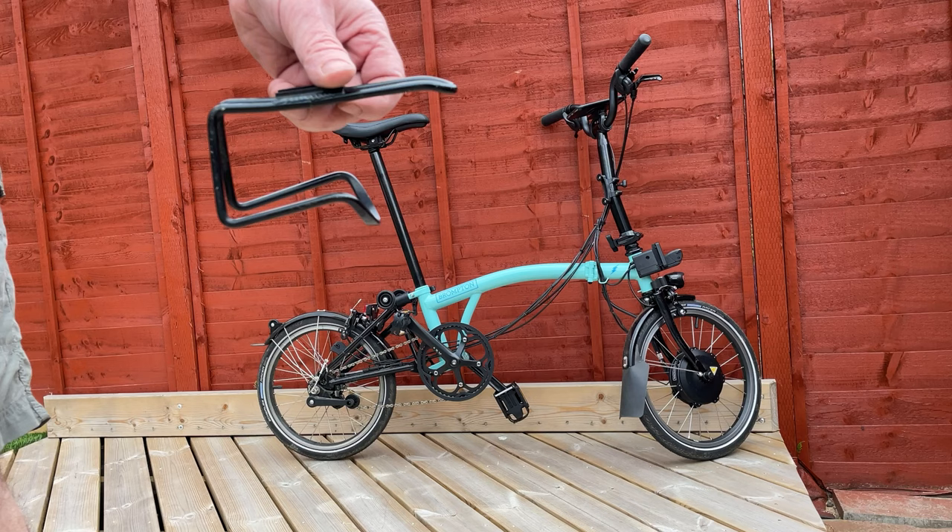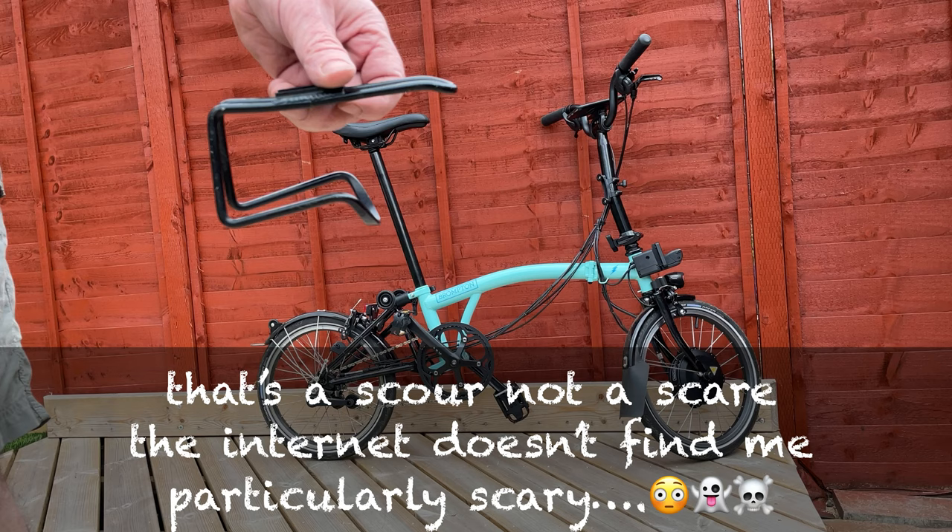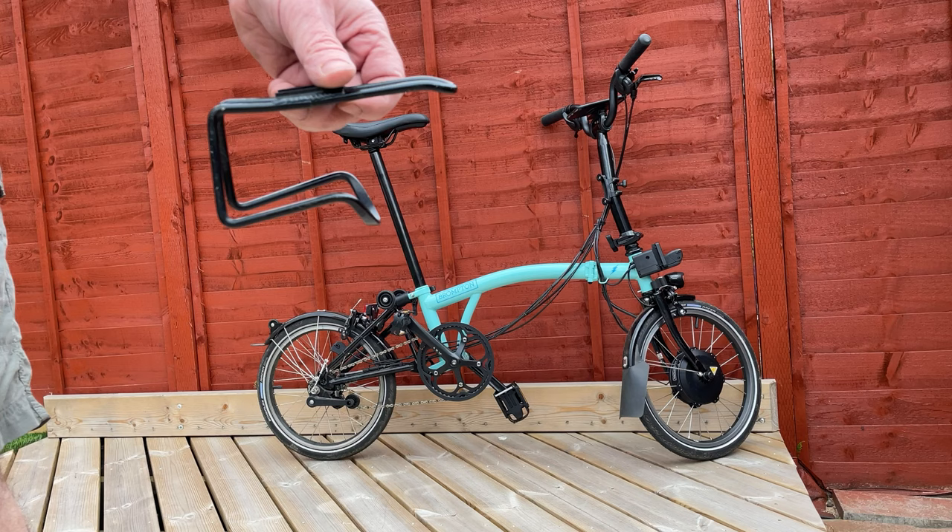I ended up with my choice, which is the Dom Monkey Cage and the Dom Clip. There's a standard generic cheap and cheerful bottle cage, the like of which you'd see on thousands of bikes. The only problem is there's no fittings for one on a Brompton. A search of the internet finds that you can get clamp-on bottle mounts, velcro ones, cable tie or zip tie ones. You could even go full on and drill holes in the frame and use riv nuts — probably void the warranty, so possibly not recommended — but there are solutions to how you can get the thing to mount.